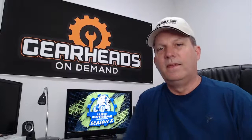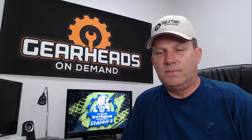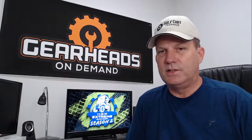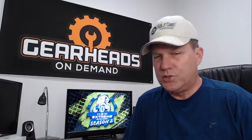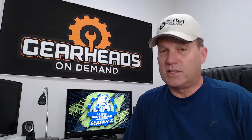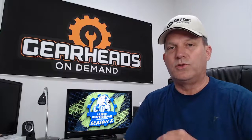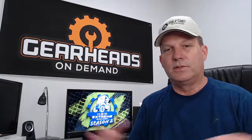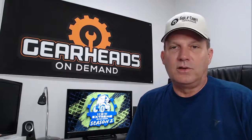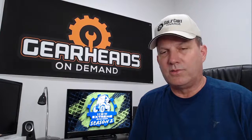2007 Club Car. All right, well, I can tell you this. The lithium unit, if everything stays the same on your cart and all you do is replace the lithium, it may help a little bit just because it has a little bit higher voltage, but that's not going to help a lot in speed. Now it's going to help a lot in power and torque because you save so much weight. Your lithium battery is going to weigh so much less than the lead acid pack that you're going to feel like you just gained a whole bunch of acceleration because you lost like 300 pounds off of your cart.